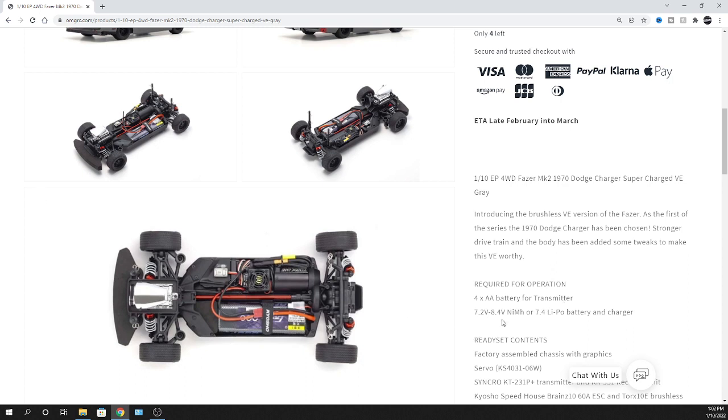If by chance you're more comfortable with a nickel metal hydride battery, you can run on 7.2 to 8.4 volts. And if you have LiPo, it's already set to LiPo, so you can run the 2S LiPo. That's it. You can't run this thing any more than that. I know maybe an electronic speed controller could run maybe 3S, but in this case you don't want to do it because it can't handle 3S, sorry. But it's a 4,000 kV, 60 amp electronic speed controller,